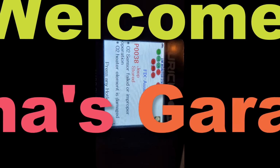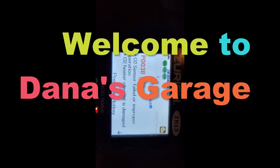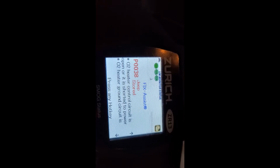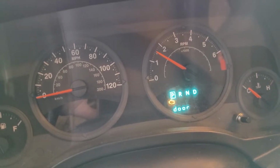With a continuation here, I disconnected that downstream O2 sensor last night, so I went to start it up. Now I got a P0038, and that's why it's telling me that it is working. So again, control circuit is open, it's shorted, powered, or grounded circuit. And yes, it will throw a check engine light.